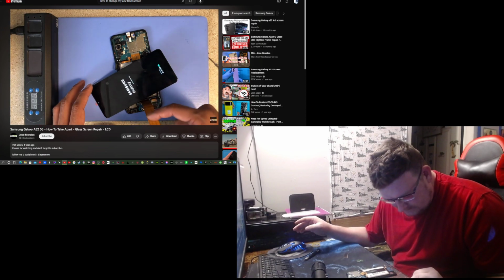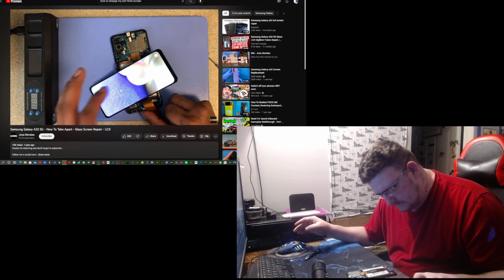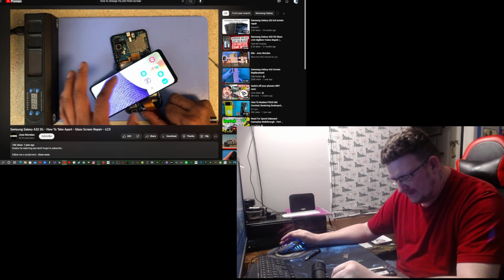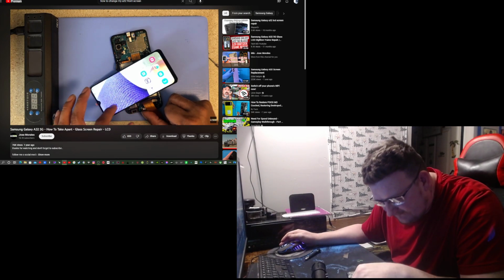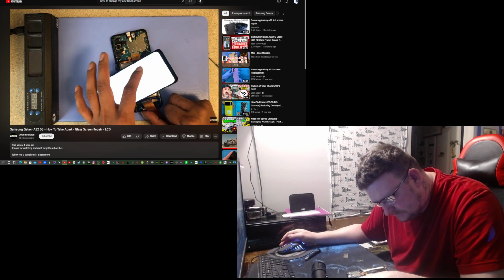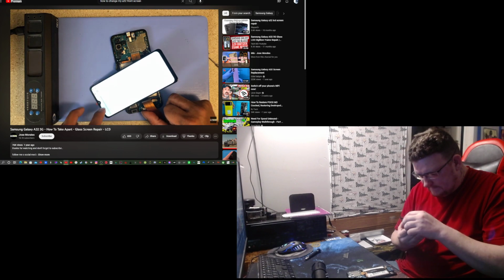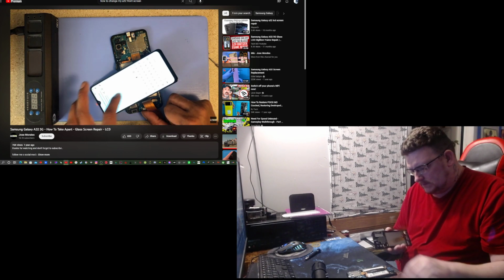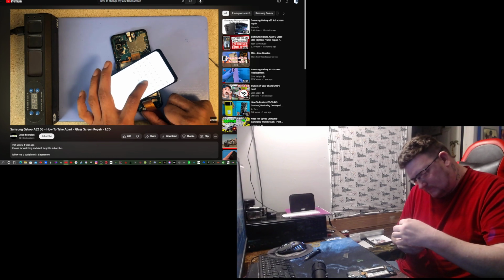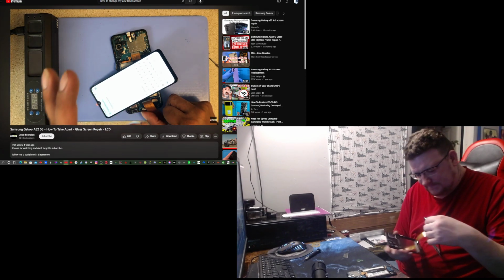All right, I heard some vibration and voila. Okay, perfect. Now we see the phone is alive. We can touch the screen just to confirm that we have good touch sensitivity. You can go as far as typing something, if you're not 100% sure this is working or not. We can always go to the browser, even if it has no internet connectivity, we are able to access the keyboard, and maybe touch letter by letter, number by number. After confirming our LCD is fine, we're going to proceed with the installation.